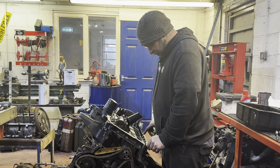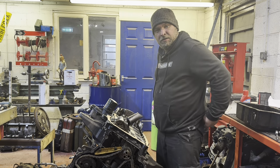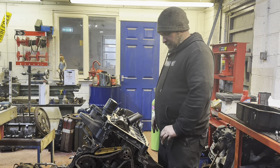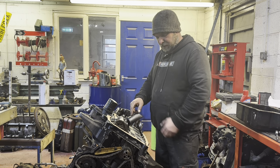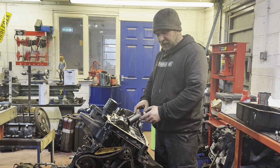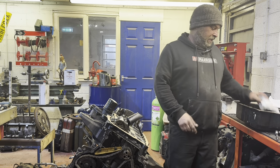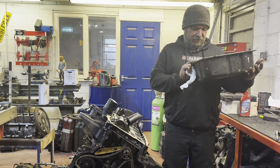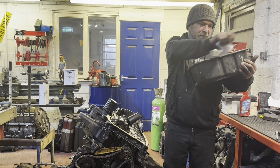And they do actually supply you with a full gasket. So a proper gasket for the sump. Not a big tube of silicone. So we've obviously cleaned any detritus, not that there really was any, but made sure that the sump strainer pickup is dead clean. Done that ages ago. And we have cleaned all of the rubbish and nastiness off the inside of the sump, including the remnants of all the old cack that was stuck on it, silicone-wise.